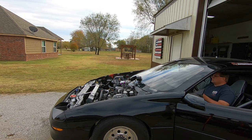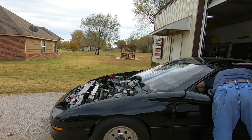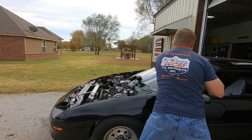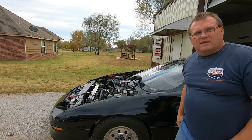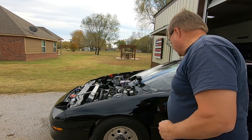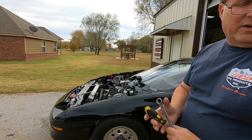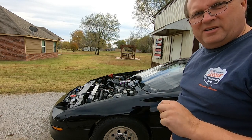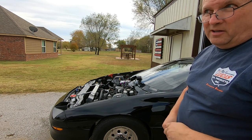We're going to go ahead and see what happens. Hey, it started! Just got one little leak here in the back I need to take care of, but just adjusting the float. Basically how to adjust that float: I get it started, kick off the fuel pump and let the fuel draw down on it, then I can adjust it a little bit, flip the pump back on and go from there.